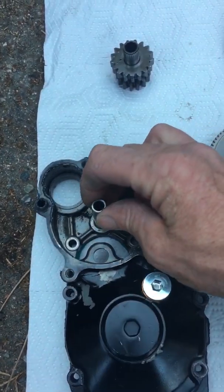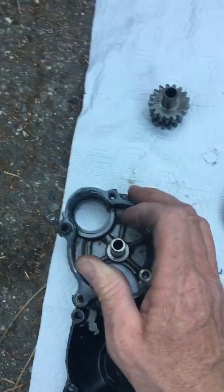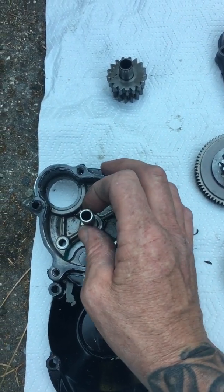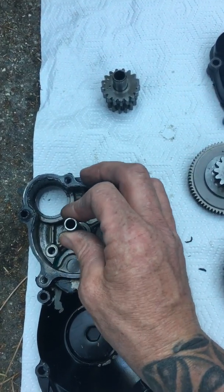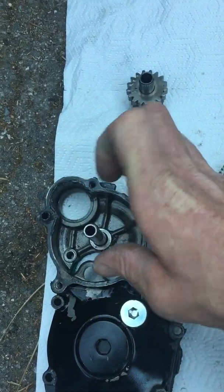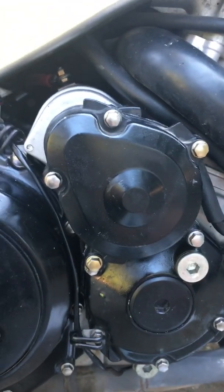What I found was this part inside the housing cover was very loose and sloppy. There are too many people talking about hot start problems to think this is just an accident — I think it was bad mold in the first place, and there's no recall because that costs a lot of money. It'll spin freely, but if you put it up at an angle — like pushing on it with my thumb — it will not turn. That causes the binding; the gears bind and it won't let it turn through and turn the starter clutch to turn the crank.